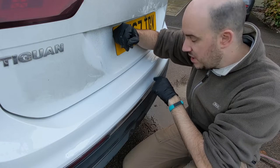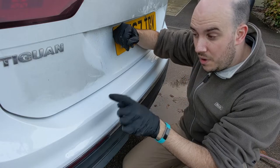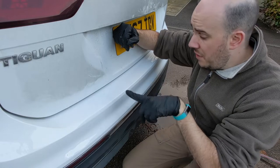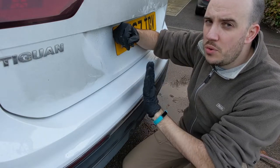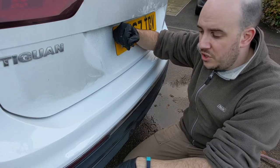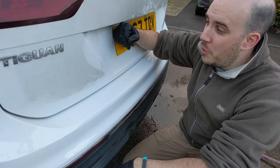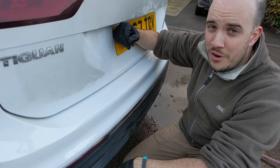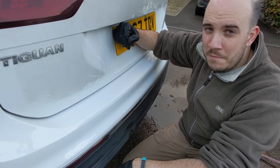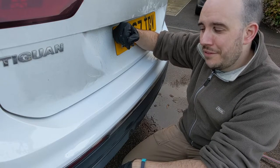Knowing that we are on the cusp in terms of the thickness of the paint and the plastic underneath, I think my attempt will actually be just going in with 2000 grit or even 2500, just to smooth it off — maybe not take the level all the way back, but smoothing it off and then polishing that out. Also, this was supposed to be going back at the end of January to the lease company but it's now the 19th of December and I think it might be going back next week, so weather permitting let's try and get this sorted.